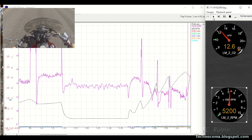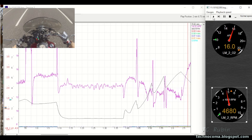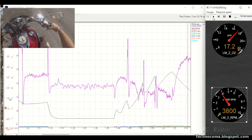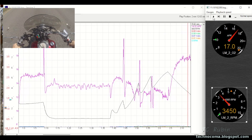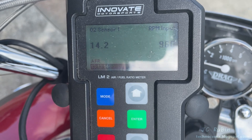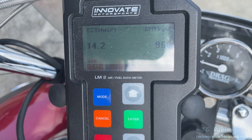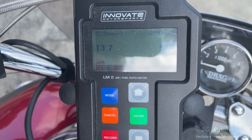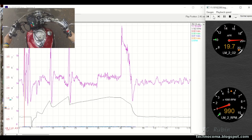We're seeing 12, and this is good - that means this cylinder would also probably benefit from a shim removal and nothing more. I let go of it and don't see it leaning out obviously, which is fine. Same exact characteristics and same issues as the last carb. The idle mixture screw has now been adjusted to raise it up to match the other cylinder. Notice the RPMs are now sitting around 980, and I sync up the camera for the next run.